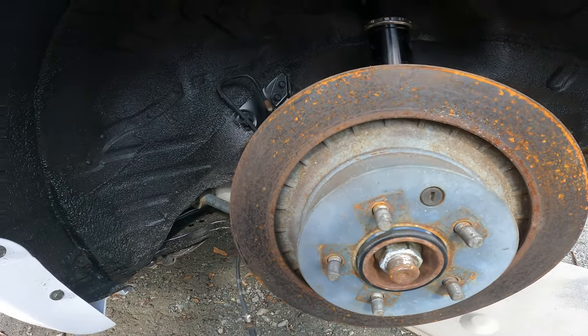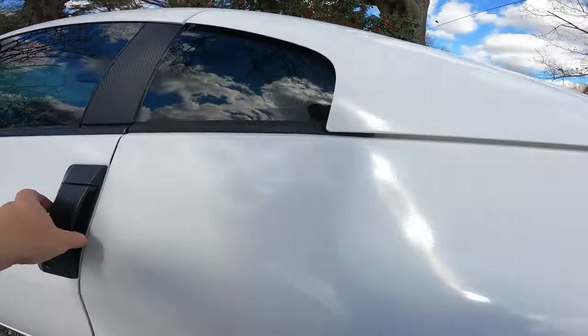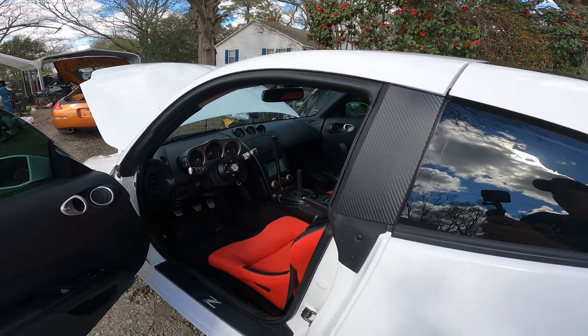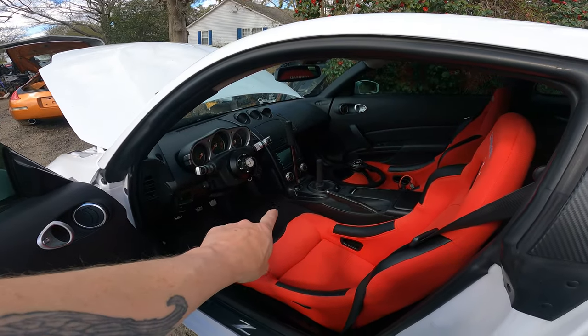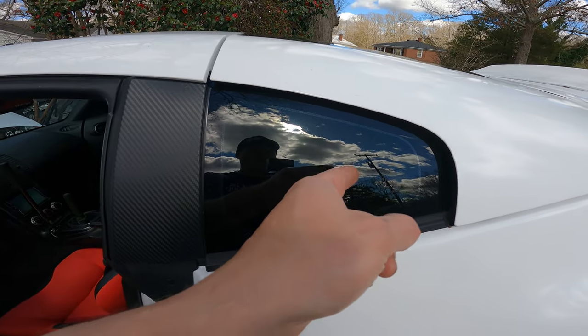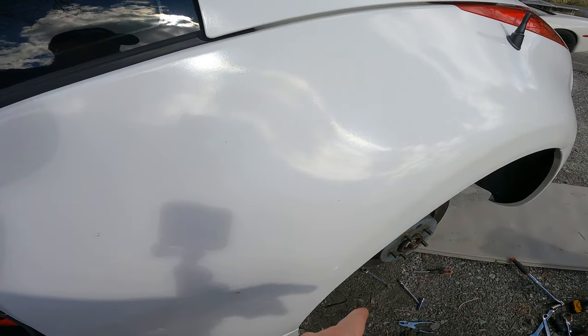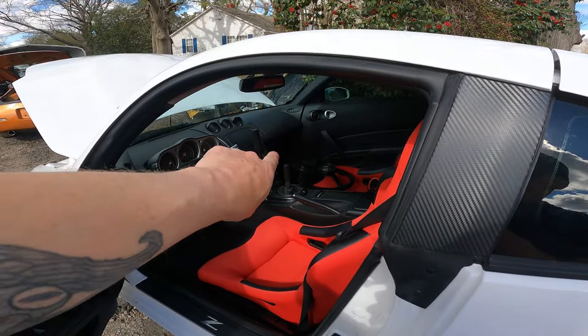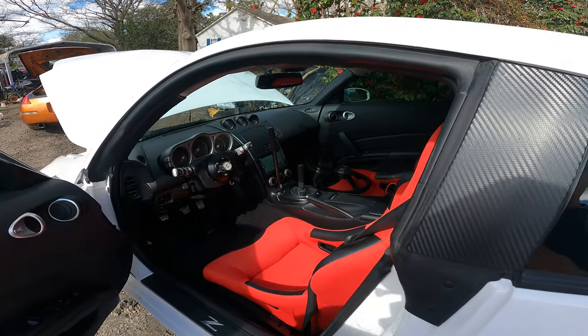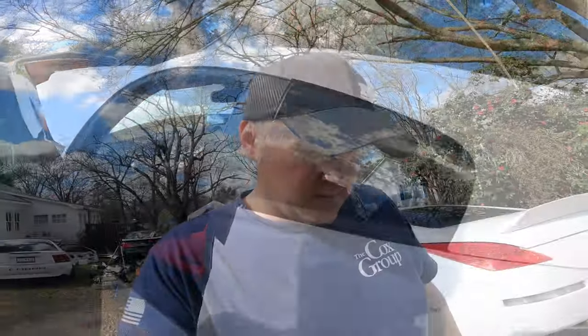Like I said, my handbrake setup is a little bit unique. That's just the Part Shop Max handbrake, and I have a hard line running from the master to a T that's in the back of the car that goes to these soft lines right here. And my reservoir to fill this up is up under that dash pad where the airbag is, so I have to take that apart. But once it's all together, you shouldn't have an issue. I mean, your brake system, unless you get a leak, is usually pretty good.